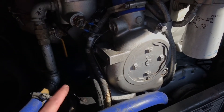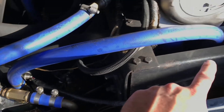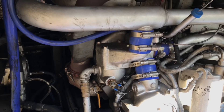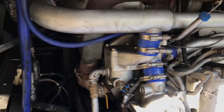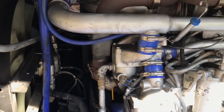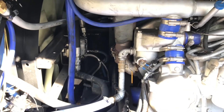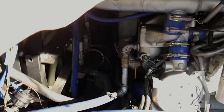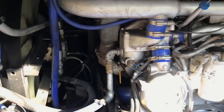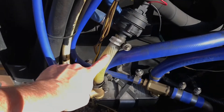My chassis heat only comes out of the engine, comes down through that heat exchanger, and then goes back into the engine. That's the only external cooling line for chassis heat that I have. The reason I did this is so I can come back here and look at all the engine cooling hoses and have peace of mind that none of my engine cooling system is compromised. With the old chassis heat system, these lines ran all the way to the front of the bus — if you had a leak up there, you'd lose the coolant to your engine.